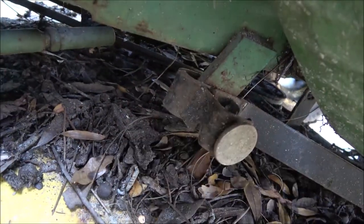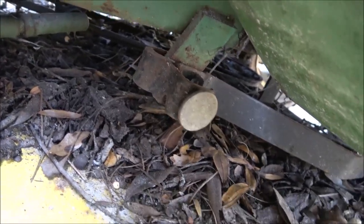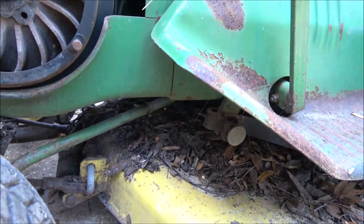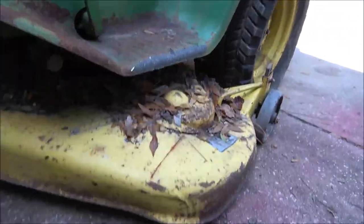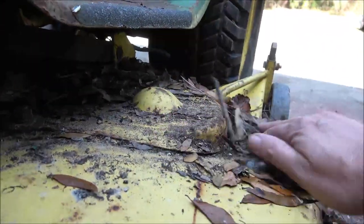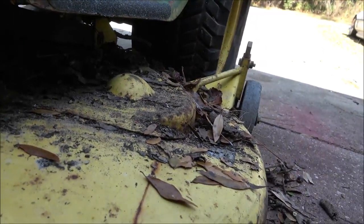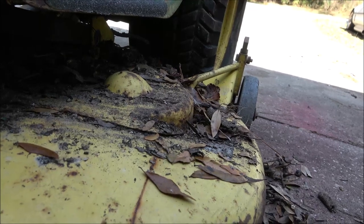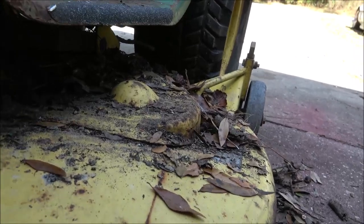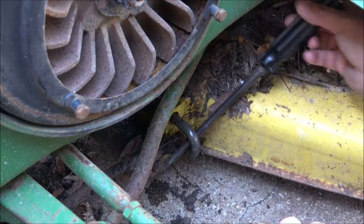So I figured, whoops, I'd have to bring something out. So let me get that sprayed down. We'll see if we can get this deck off of here so we can take these covers off and see what's seized up. These old bearings, this is a '74, sometimes you could get them freed up and re-grease them and they would be all right, but let's just see what's going on with it first. All right, I pried it a little bit with this screwdriver, started moving.